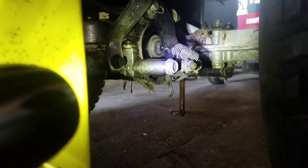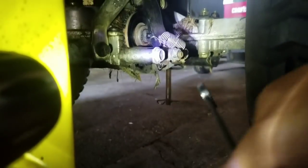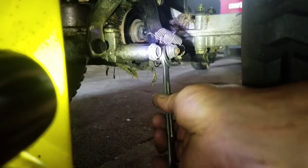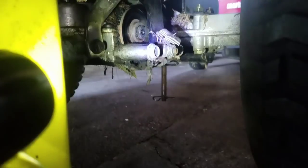I'm going to hold the camera with one hand since my tripod isn't short enough. This outer lock nut I'm going to loosen — it's a half inch. Now I'm going to loosen the inner nut. The inner nut is a lot easier to move. See? I just loosened it and that brake lever moved.